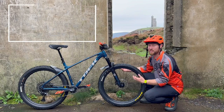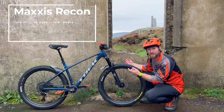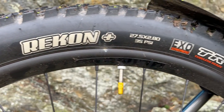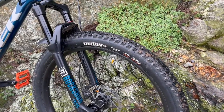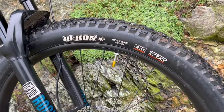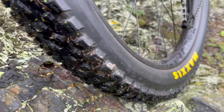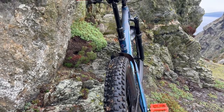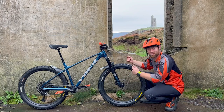Here's something I've really enjoyed: in two years of riding, I have yet to have a puncture. These are tubeless-ready Maxxis Recon 27.5 by 2.8 mid-fat tires and they are awesome. They are fitted on Bontrager rims, 28-hole, 40 millimeter width with Presta valves. It's a nice setup — you don't need to replace this. This is good stuff.